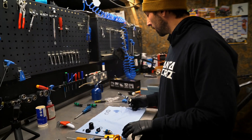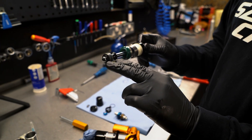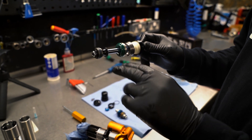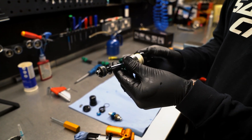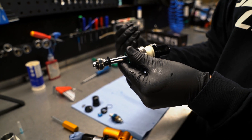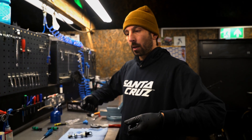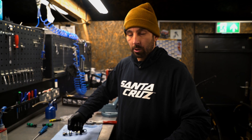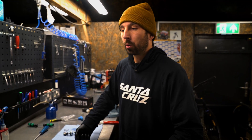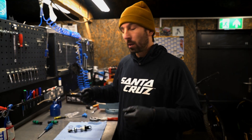We'll take the main compression assembly apart now. This is the piston and glide ring. You can see the two sets of shims either side of the piston — these help to displace the fluid. We can actually change these shims, these little thin washers, to change how much resistance or how much force it takes to push that piston through the fluid. It's a little bit like having a plate underneath the water in your sink when you're washing up — you try and pull the plate out really fast and you've got to displace all the fluid off it.